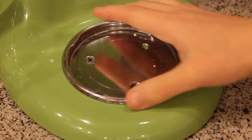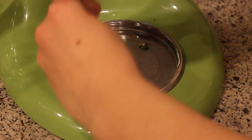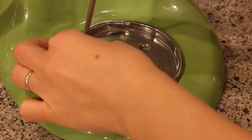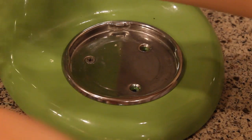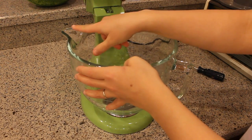So what I did is — this is the plate that holds the bowl. I already took two of the screws out, but if you unscrew this plate, it's actually not symmetrical. If you unscrew the three screws, you can pick it up and rotate it, then put the screws back in. Now when you put the bowl back in, you can see the bowl is locked into place and the spout is well away from the back of the mixer.